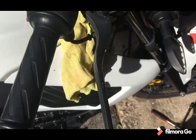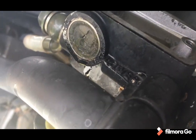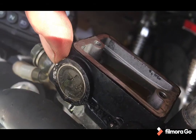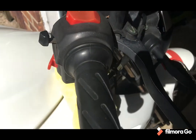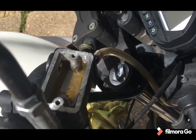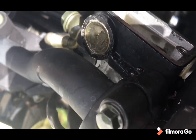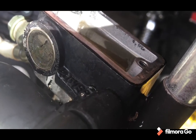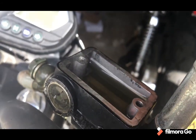Although it's fine at the top end, that front crack just lets all the fluid come pissing out - you can see a drop forming there. I can't think of a way of repairing the front reservoir. I might just go for a new front reservoir. What I'm going to do is drain it - I was just trying to top up the fluid but it's cracked and coming straight through. No point trying to block it - I'll just get a new one. Safer. Going to siphon that out so it doesn't drip and ruin the paintwork.